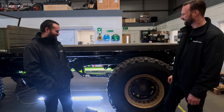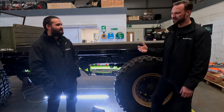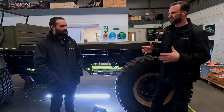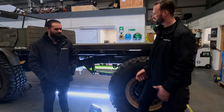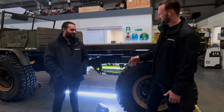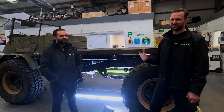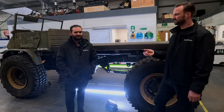You saw the Tesla battery go in, and someone in the comments pointed out — correctly — that by sitting the Tesla battery directly on the chassis rails we compromised the twist-and-flex ethos of the Unimog. That's the biggest thing we've done in a rush that we're not happy with. We're going to take the Tesla battery out and put it in the bed. On top of that, the Tesla battery's voltage is 350–400 volts, whereas our drive motor is happiest at around 600–700 volts, so we're looking at changing the battery system.